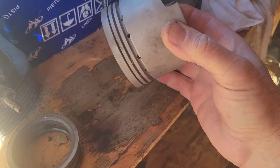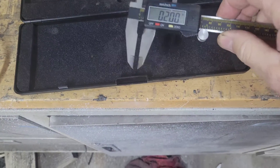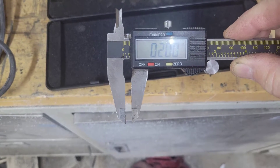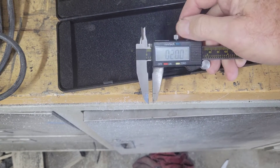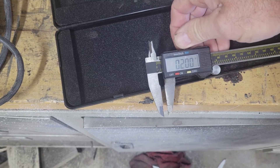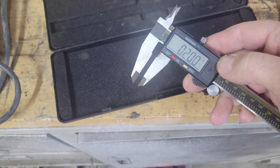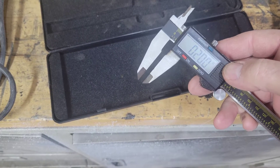It's not a big deal and it really won't hurt the piston. Some of the tools you need are a caliper — they sell these at Harbor Freight and they work fine. It doesn't need to be exactly 200 thousandths, but set it at 200 and then tighten this little set screw right here. Tighten it up at 200. The trick is to make them all exactly the same. It's really not rocket science — it's really not hard to do.